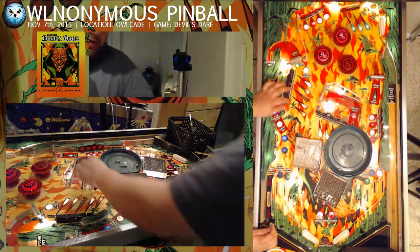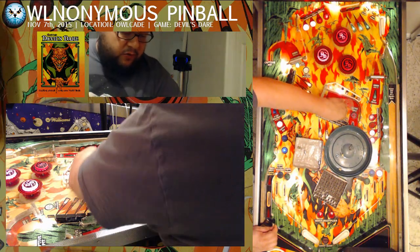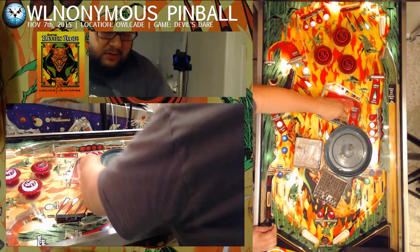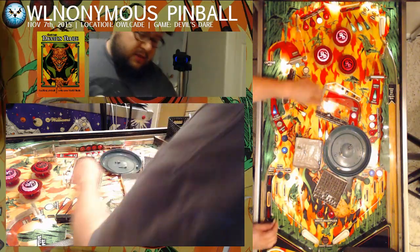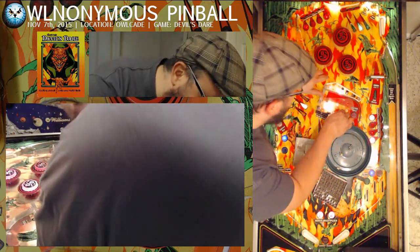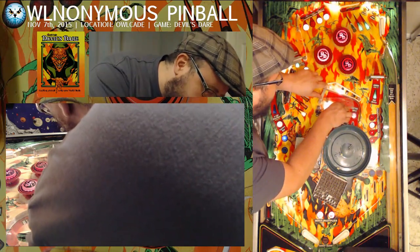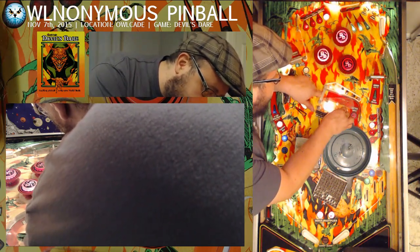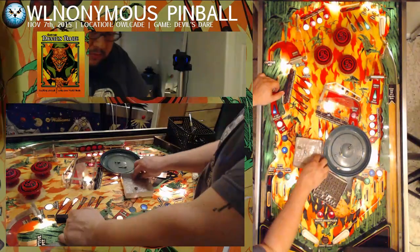I see part of the problem with that ball bouncing up. It looks like this gate right here is out of the wood, and they just put a nail underneath it, behind it, to make it not go back. So it's giving away too much as opposed to taking the hit, and it's bouncing back. So that's not good. Often, I don't know, man, more than 50% of the time when something doesn't work right, it's because it's been rigged to work by a person or an operator.